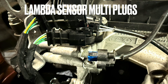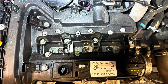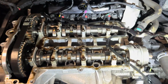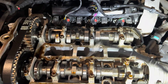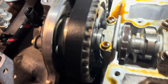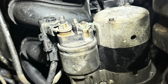Now let's unclip the remaining wiring and remove the wiring from the top of the engine so that we can remove the coil packs. Then we can remove all the bolts in the rocker cover and remove it. Don't worry too much about the gaskets — if you get a decent head set, these will be supplied with the kit. Now you will be able to see the wet belt and the cams. These do deteriorate and will need replacing, so don't skimp on parts.